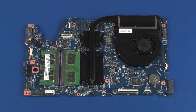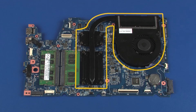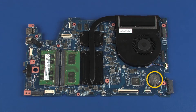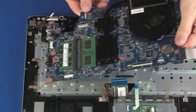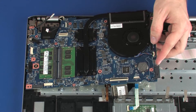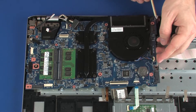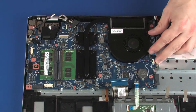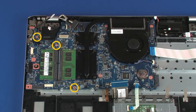Replacement. Before installing a new system board, remove the following from the old system board and install on the new system board: fan heat sink assembly, memory boards, RTC battery. Toe the external connectors on the system board into the cutouts in the top cover and lower the system board onto the alignment pins on the top cover. CAUTION: Ensure that all the cables are free from being pinched between the system board and top cover. Replace the three 3 mm P1 Phillips-head screws that secure the system board to the top cover.